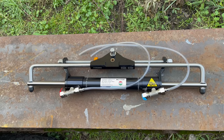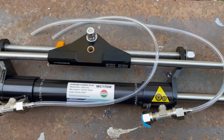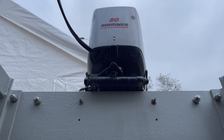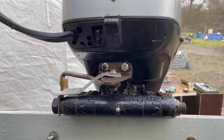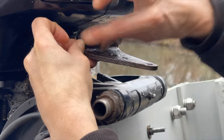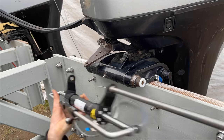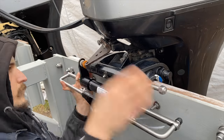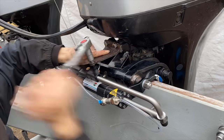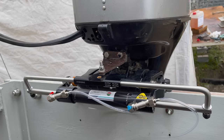Let's start by installing the hydraulic cylinder that's gonna allow us to steer the motors. A single cylinder should be enough to steer both my motors, and I'm gonna install it on the port side motor. First I have to remove that locking bracket. I clean the inside of the steering tube and then install the hydraulic cylinder. Because I have no idea what I'm doing here, I'm installing the plate of the cylinder at the outermost hole of the steering bracket, which will turn out to be a mistake later on, but let's not worry about that just yet.